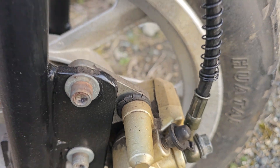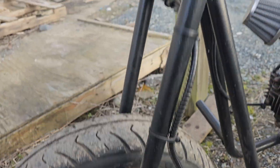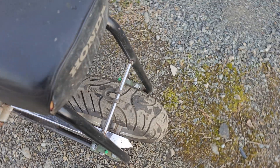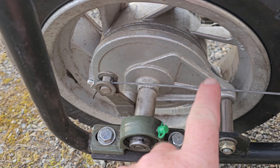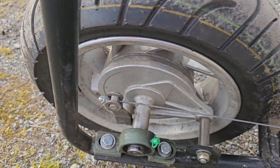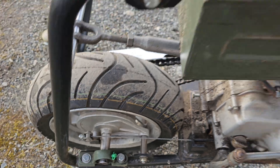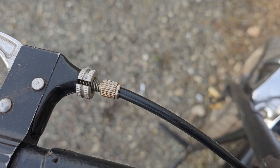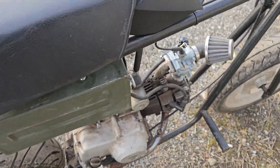We made a little disc tab to mount the piston to the fork. Out back we hooked up the rear brakes — they're cable-actuated because we have a drum brake. There's a cable that runs up to the front and to this arm right here, so when I squeeze the lever it pulls the arm forward, actuating the brakes. This is actually just a mountain bike brake lever with a 5mm oversized heavy-duty brake cable.